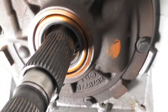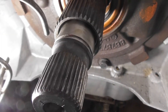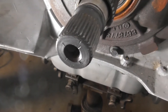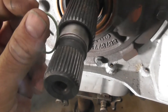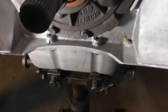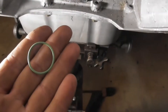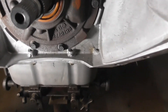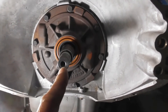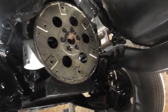Down in here is that O-ring groove. There — this fancy little green O-ring goes on there, and that is for your lock-up converter. If you don't have that on there, you don't have the lock-up converter. I'm going to oil that up, stick it on there, and then I'll dump a quart of oil in the torque converter and install it in there. And hopefully you can lift her up and bolt her on the back of the engine.